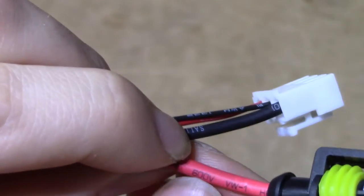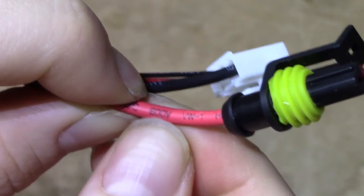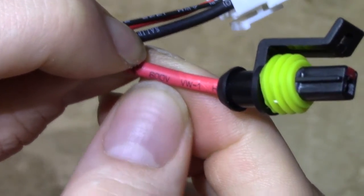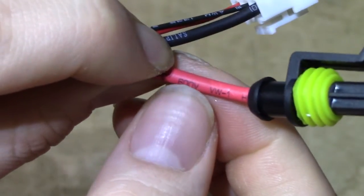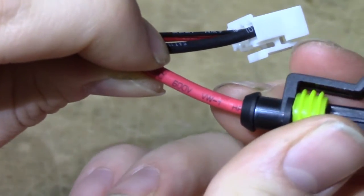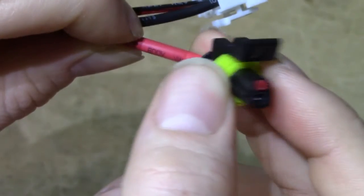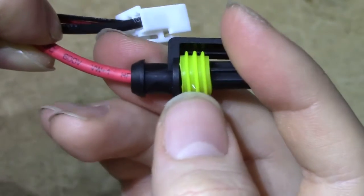Another thing I noted is that the high voltage cable is only 600V rated, which I'm not certain about regarding the requirements for the igniting circuits on these things, but we're going to try putting a grounded needle against it to see if we can actually make it spark through the cable. If 23kV is a true figure, that might not be entirely inconceivable. At least the connector they've used is one of these waterproof couplings, which seems to be of fairly high quality.